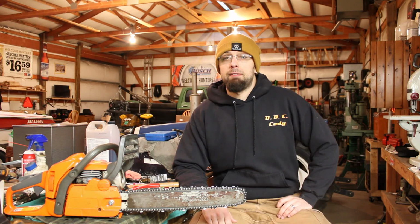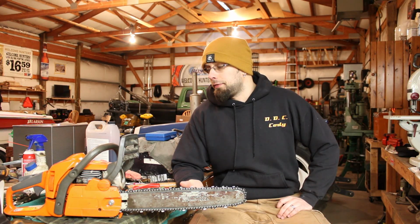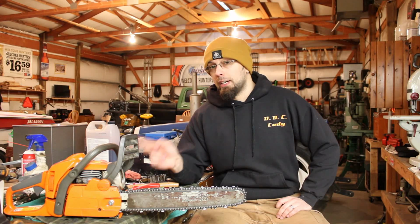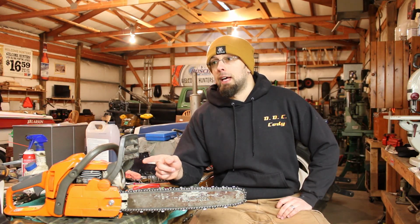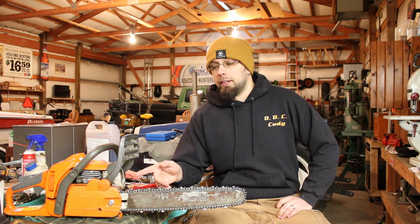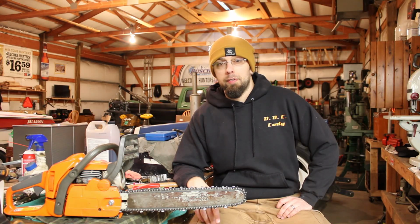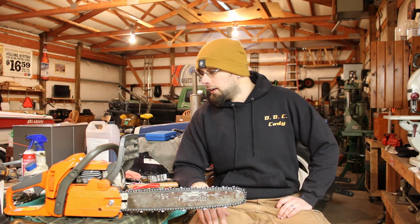So just to recap everything that we did: pulled the carburetor off, cleaned that, replaced that chunk of fuel line that goes into the tank, put a new pickup on there, and ended up originally swapping the coil that was on the other saw, and I should go back and check that one. That one might actually be good. I never ohmed any of those coils out, but I believe the spec that I saw in the manual was 5 ohms. I might want to double check that though, but there is a service manual available online for these. Just Google Husqvarna 435 service manual. It's right there, first link.